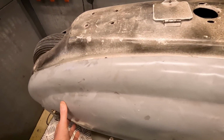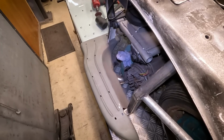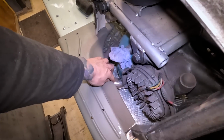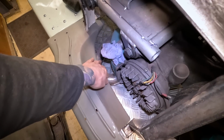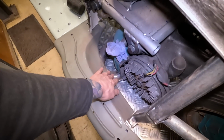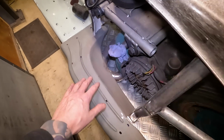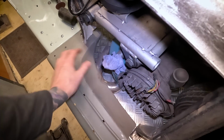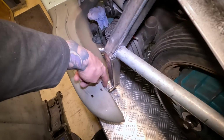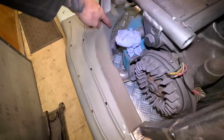the other footboard done. We're on the passenger side footboard, and I did remember there was an issue here, and I couldn't remember what it was, but with this engine raised so high, the footboard is hitting the exhaust. Now I do appreciate that might not be the final exhaust position, but I think whatever exhaust I run, I'm going to have this issue. See, it's about an inch or even maybe more, 30 mil off there.